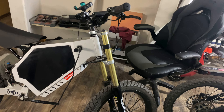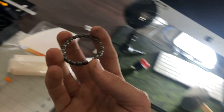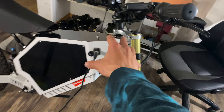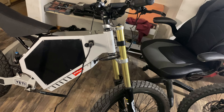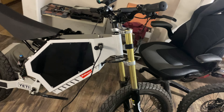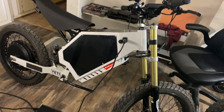I'm assuming you guys use the bearings that came with your frame. Here's actually the top one — as you can see, one of the balls came out and it's all bent. These are OK for most bicycles, but I don't think they're very solid for this type of enduro e-bike. There's a lot of force being put on these forks, especially when you hit that front brake. That just ended up bending mine and breaking them, making it super hard to turn and preventing me from fully tightening it so this would move back and forth.